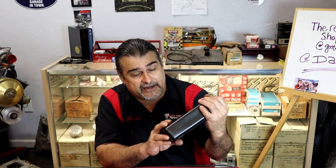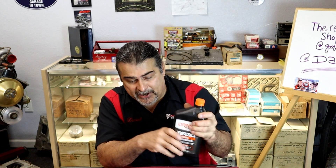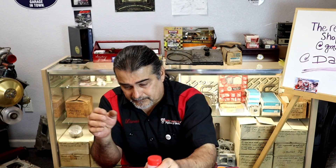You can find non-detergent straight 30-weight oil and add a zinc additive — that can work. Lewis from Hill Country Car Country magazine has been using non-detergent oil with additive for three years for his cam break-ins and it's working perfectly fine. We use a zinc break-in oil — specifically Driven Joe Gibbs break-in oil, which is ZDDP-formulated for cam break-in and high in zinc. We also use AMSOIL break-in oil; about 90% of our high-end engines are broken in with the AMSOIL high-zinc break-in oil.